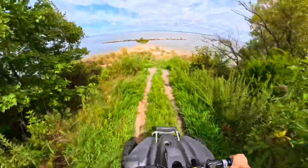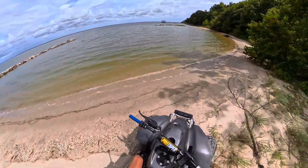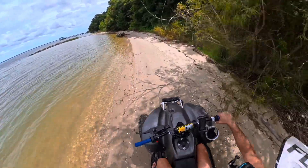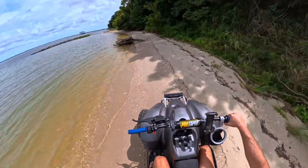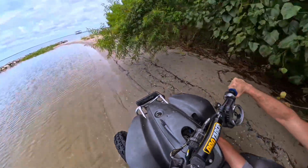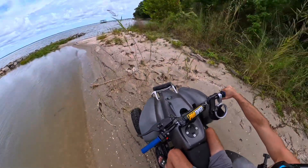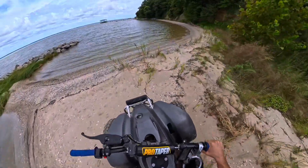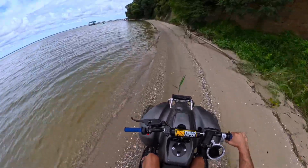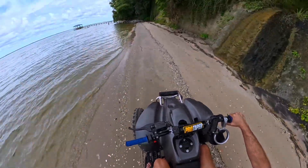What I would recommend is a bit of a life hack I found. With this hack, you have to be able to build, and these are not small battery packs — these are the large cells I used to build the pack in my Murray Kilowatt, which is a 26S pack. The drawback is you can only buy them in 63 amp-hour at the price I'm going to mention. 63 amp-hour is a huge cell — if you take 20 of those in series to get a 72-volt pack, that pack is going to be huge. Too big for a dirt bike, too big for a mini-cart. This would be for your four-wheeler builds and larger go-kart builds.